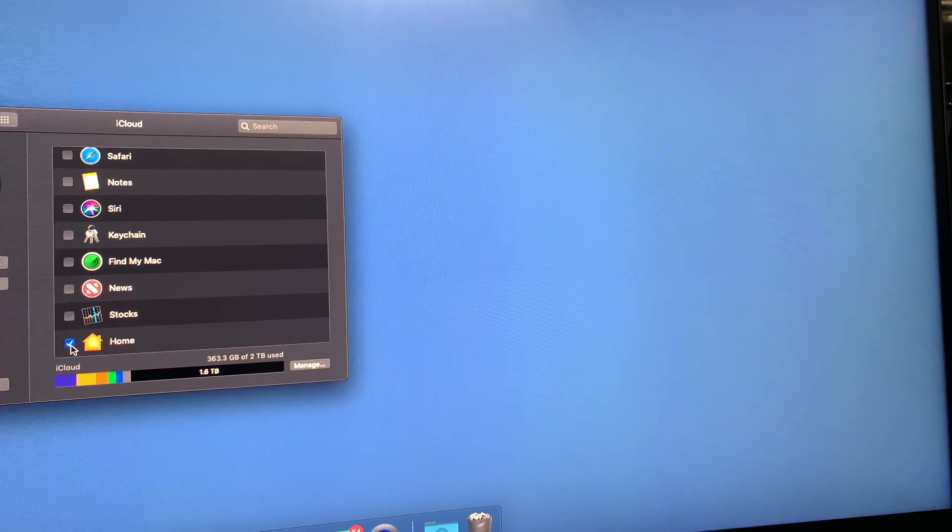The first thing you want to do is go into your Preferences, and particularly into iCloud, and make sure everything is unchecked. When you uncheck something, sometimes it will ask you to either keep passwords on the computer or delete them — you always want to select delete them. Then you're going to want to actually sign out from your iCloud and iTunes account and make sure that is done.